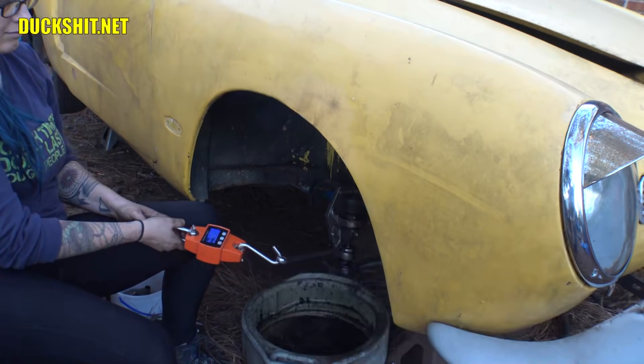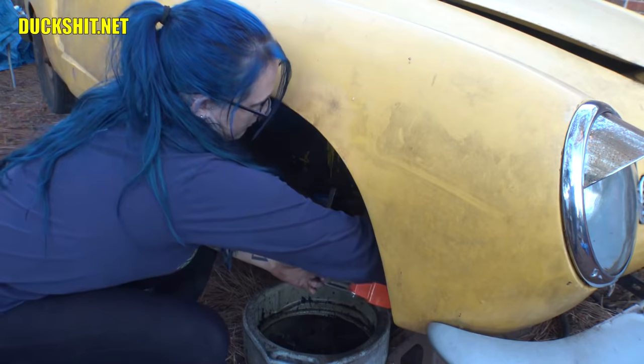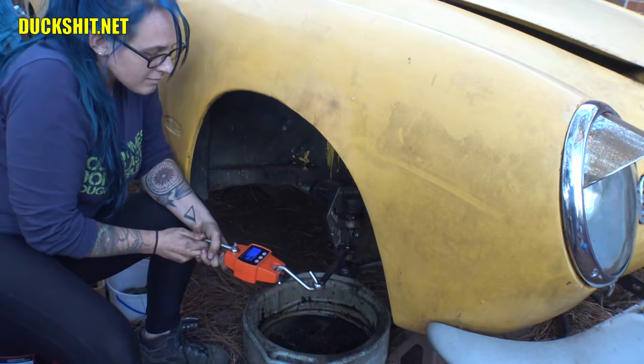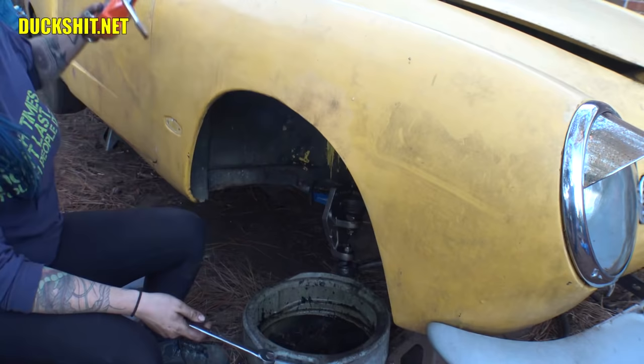Pull it straight. You're not pulling straight. No, no, no. Yes. I might have to move the wrench. Yeah. You want to be roughly 90 degrees to the wrench. Otherwise, you'll get some unusual numbers. Here? Yeah. Look for your 67 and then stop. I can't read that first digit. Yeah, it's a little hard to read, but I think you hit 69, so you're fine. That's what it looked like to me anyway. Nice. The numbers were pretty rapidly changing. Yeah. Now tighten up the top one and then repeat the process for the bottom.